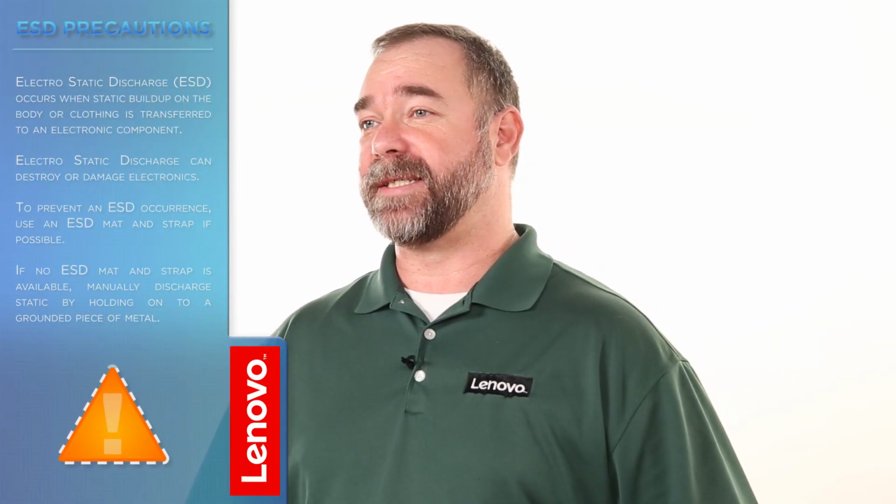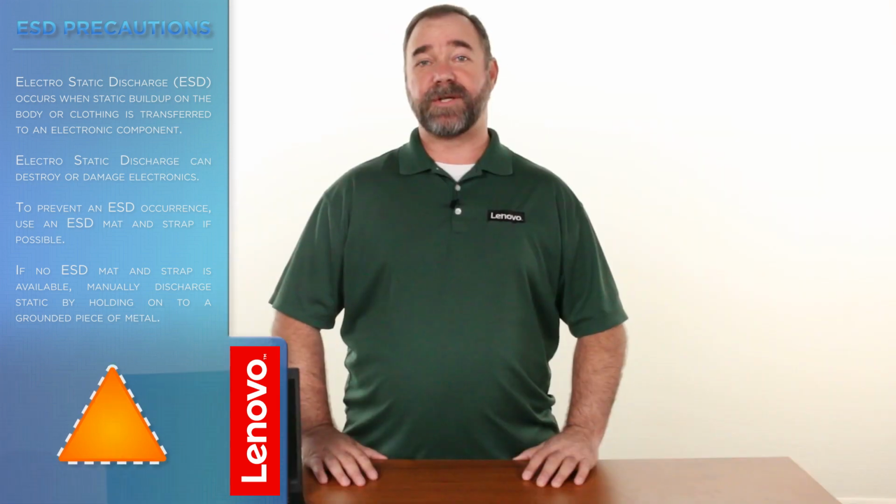Before we continue, we need to make sure we're protected against electrostatic discharge, or ESD. Make sure to shut down the computer and disconnect all cables and accessories from the system. For further information, watch our Understanding Electrostatic Discharge video by clicking the link in the description. We can now place the system on a hard flat surface in order to begin.